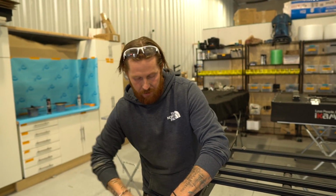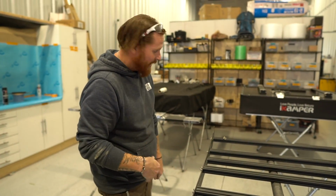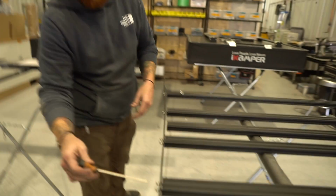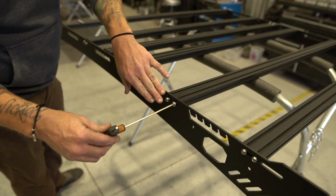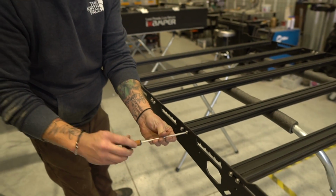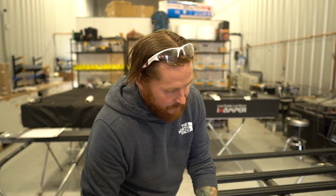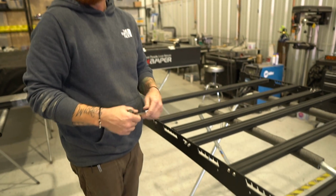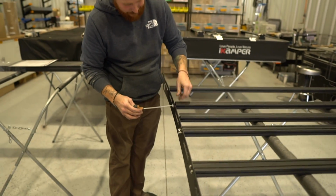It's not a wheel. It's good to know, because a lot of guys do use power tools. That's it. So then we'll tighten up these. And this is 5/32. So the exterior of the racks for us, the load bars, that's all Imperial hardware, SAE, quarter 20. And we do that because if you were to strip this out in your driveway, you can always find a quarter 20 tap at Home Depot. You're not going to find an M6, an M8, or whatever.